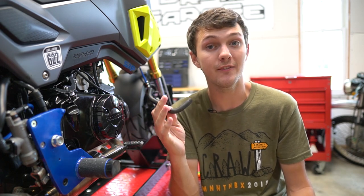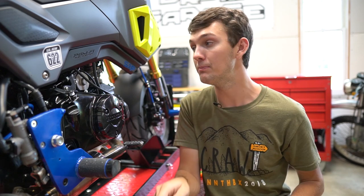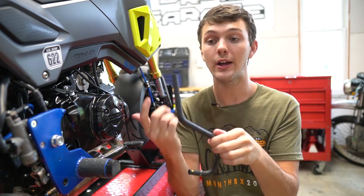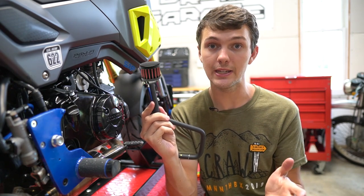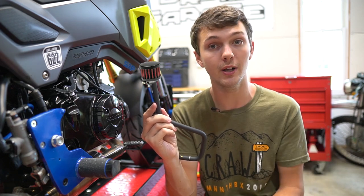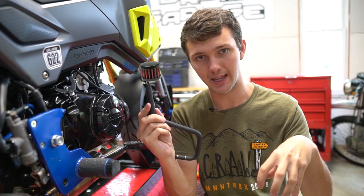But while I'm at it, I'm going to go ahead and fix the situation altogether. Where this line went from the crankcase to the intake system, I will be blocking off my intake system, and the new line will go from the crankcase straight out to the atmosphere. Now, I don't want junk getting in there, obviously, so I'm going to put a small breather filter on it. I don't have one yet. I'm going to grab one tomorrow. I just wanted to go ahead and film this video, but I'm grabbing one tomorrow from my local store, which is Baker Motorsports. So I'm putting it on there, and it's done. Then if it ever overfills again, oil will be getting on top of my engine versus in my engine.